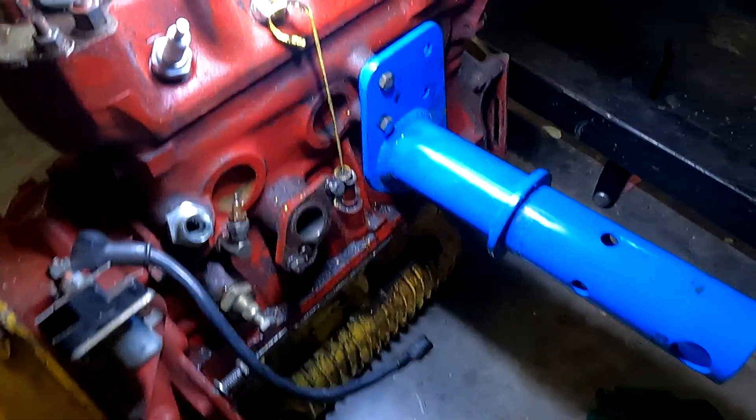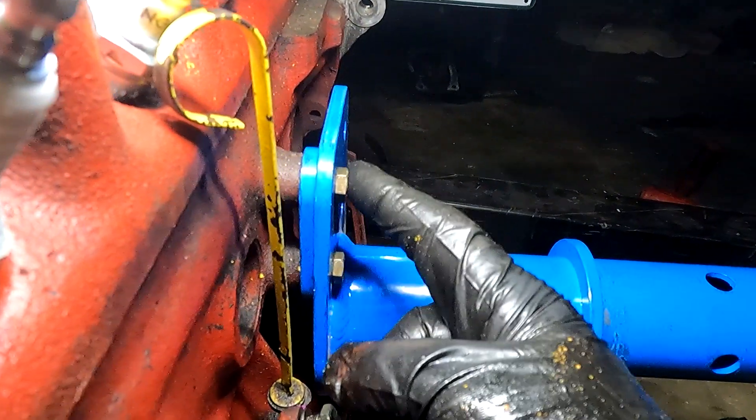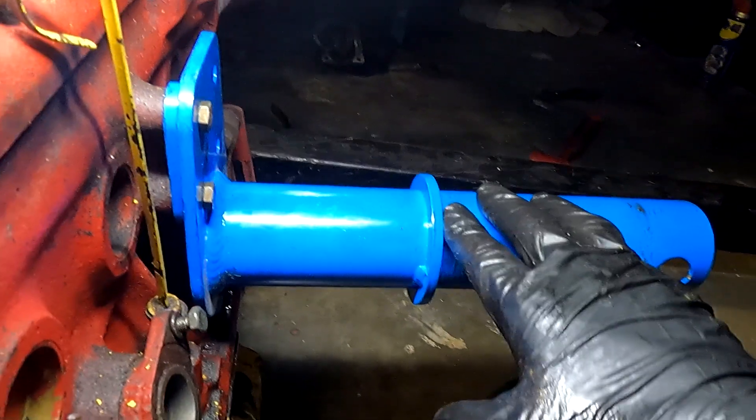As you can see, it is completely mounted. I did have to use one of the spacer plates behind here to space it out so it's actually square — make sure that you use longer bolts as well. Once they're in, you're ready to go and mount this on to a standard engine stand.